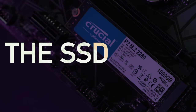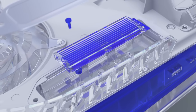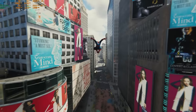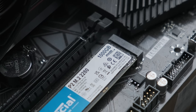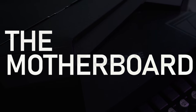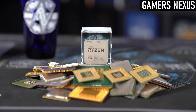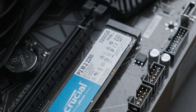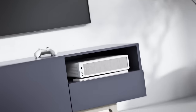Storage would become another area of regret. Whereas the PS5 and Xbox both make use of Gen 4 PCI Express, the 4700G processor does not. Regardless of my choice of motherboard, any Gen 4 SSD I use would be limited to Gen 3 speeds because of this bottleneck, and for all I knew this could prove to be a limiting factor. On the other hand, it did mean I got to cut corners on some components, so I'm reusing a cheap Gen 3 1TB drive I've had for a couple of years. The motherboard was another corner I felt the need to cut. This Gigabyte Gaming X motherboard is a full ATX size unit using the B550 chipset, so if I chose to upgrade the CPU to a 3700X or 5700X later on I'd be free to do so, though I've already locked myself into a Gen 3 SSD. If I were pushing the boat out for a full version 1 of this build, I'd probably go for an ITX board instead, but for this proof of concept it'll have to do.